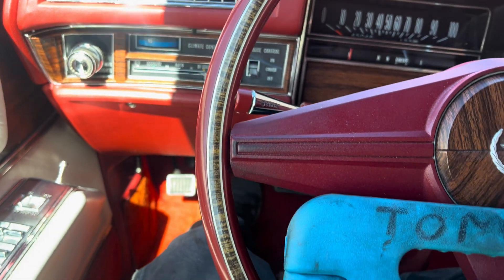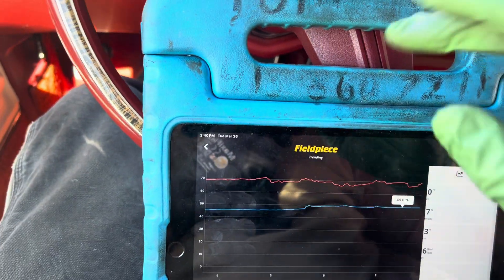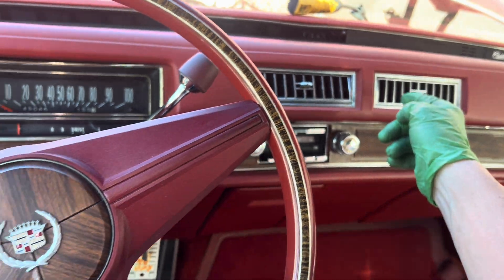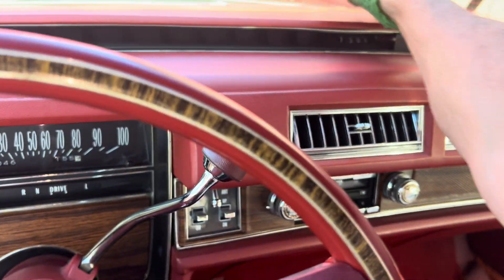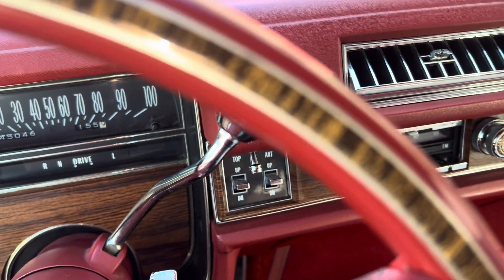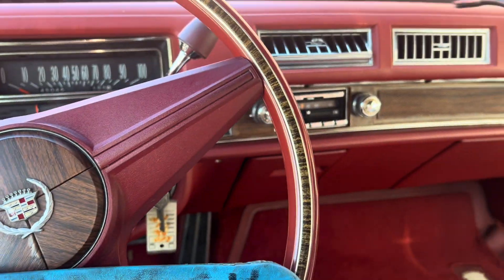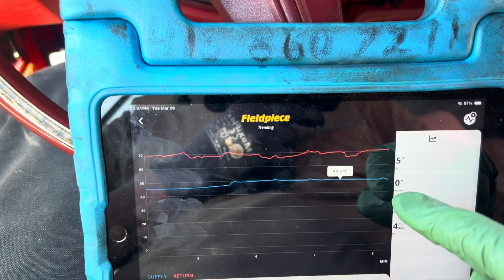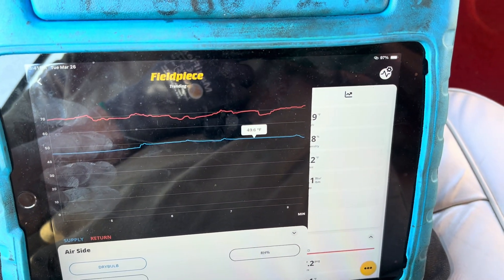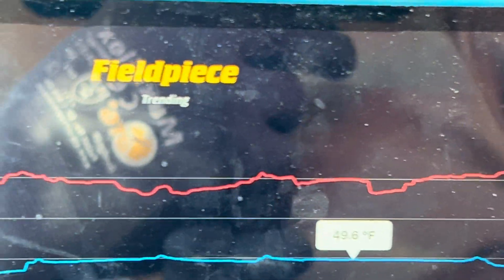Something came out of here — finally, enough times of playing with it, it works. The diaphragm and the valving just moved and now it works. Maybe it won't have to be rebuilt or bypassed. When guys don't want to repair them they get underneath and mechanically bypass them. Now we're taking a dip — temperature is going down. We're at idle with this 500 cubic inch engine.